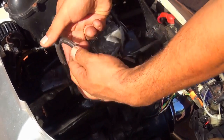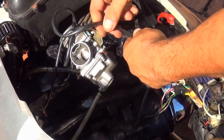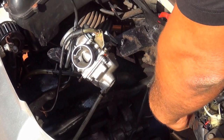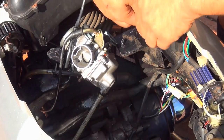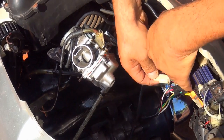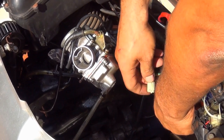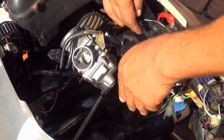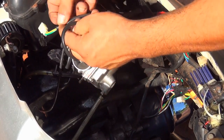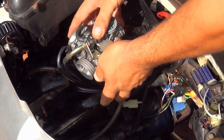After removing the bolt underneath and releasing the drain hose, you can pull the drain hose up. Now you have the connection for the electric choke, also called the enricher. Be gentle finding this wire — the connection is usually on the right side of the scooter body. Disconnect it by pulling the connection gently, as pulling the wire too hard can damage the wires.